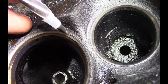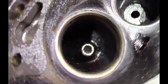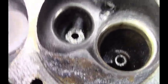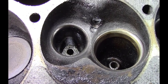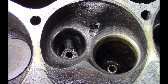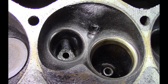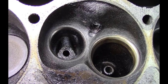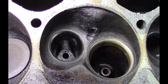And there's some pitting around this area too in the seat itself. So that is, I would say with pretty high confidence, the reason why the compressed air was blown back out through the intake port in the previous segment. So it looks like we're going to have the valves and seats ground. We'll go ahead and ship these off to the machine shop.